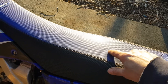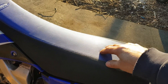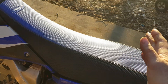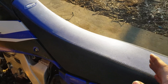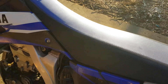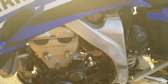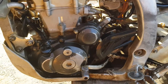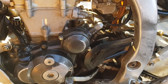So I went and got a new battery, put it in, had my 12-volt reading, and thought I was good to go — but I wasn't. I went to ride again and after half a day the battery was dead again. I thought it was a defective battery, but after learning on my own, it turns out it's the stator.